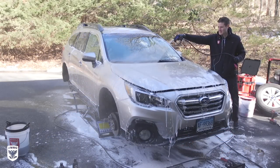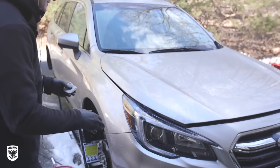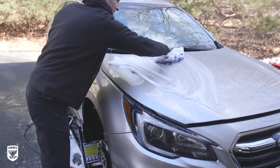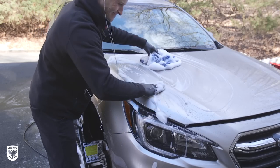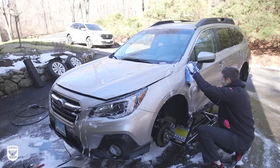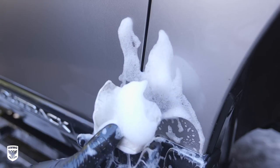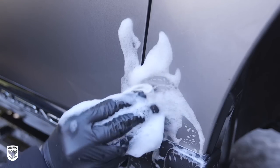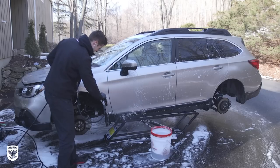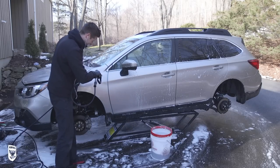After my final rinse, I decided I needed to quickly clay the top side — the horizontal parts of the paint — and the driver side of the car, because I left it out under a tree while I was cleaning the R8 inside the garage the other day. So I don't need to clay the entire car, just the spots I feel require it. Use your judgement on your particular car — if it needs it, do it; if it doesn't, don't. After clay, I quickly rinse again in case any contaminants are lifted but are just sitting on the surface.